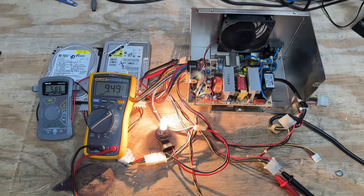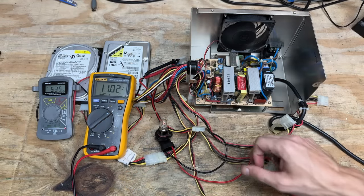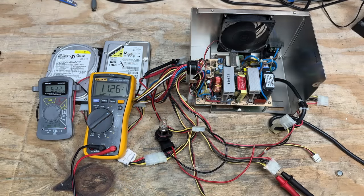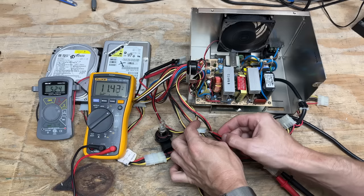That's not looking good — just dragging the 12-volt rail all the way down to 9 volts. And because of that, the sacrificial hard drives can't start. Let's try just disconnecting that bulb. Yeah, there we go. So yeah, that power supply is pretty weak. I'll just give it some time to suffer, even though I'm definitely not using it. I'm not putting this much cool hardware at risk. But I want to see this thing suffer — I'm plugging that bulb back in. That trips the short-circuit protection.